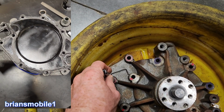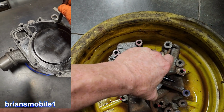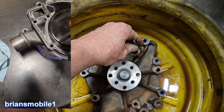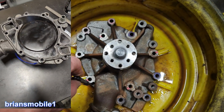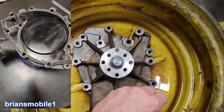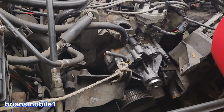But it doesn't fit through the bolt holes. So when you're lining up the gasket, and this is flipped over to the back side, when you put this in it, it lines everything up. Both gaskets, the water pump, and the backing plate. 4 things at once. Wiggle it around, go to another bolt hole, wiggle it around, so on and so forth. And that way everything's all lined up before it leaves the table to be put into there.